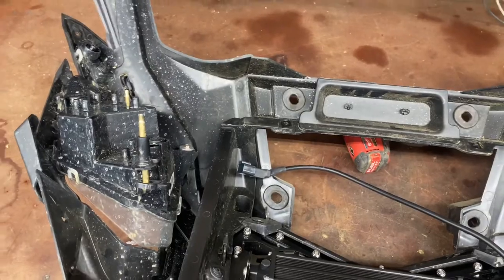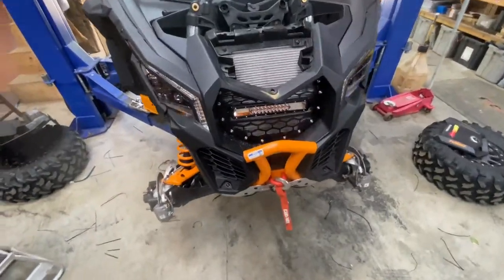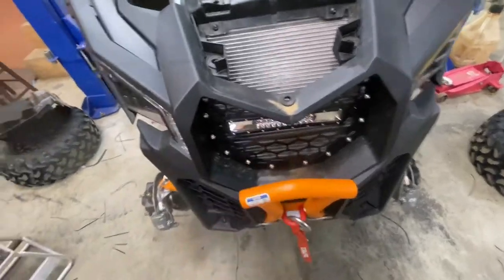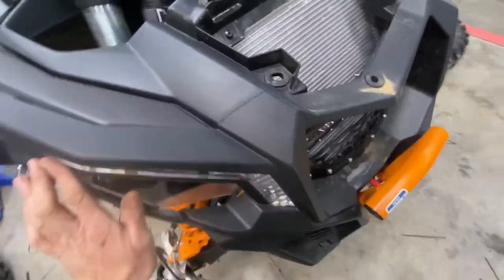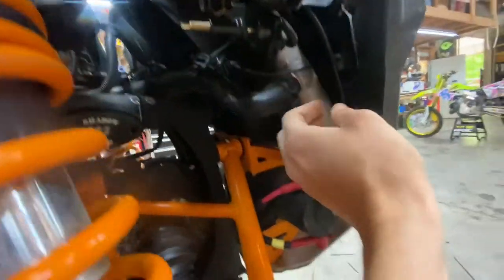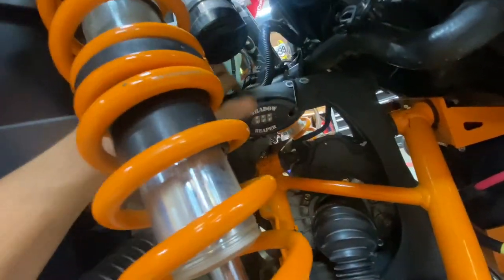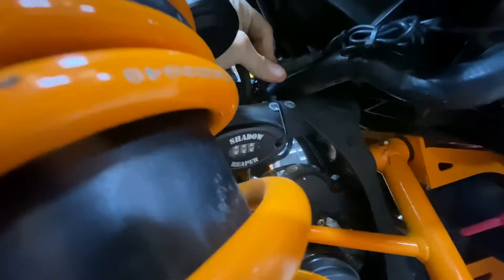Continue with your other accent light and then your grill is done. Once you get your grill and front nose back on, we've got our light bar and our new accent lights with multi-color LEDs in them. The old accent light plug you'll just zip tie out of the way. Drill a hole through the side for your light bar wires. I put a four-way splitter up here so that if you want to take the nose off, you just unplug the accent lights and the whole nose comes off. Make sure wires don't get in the fan.